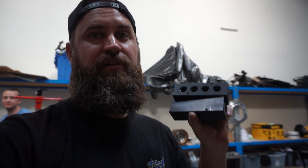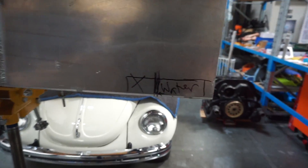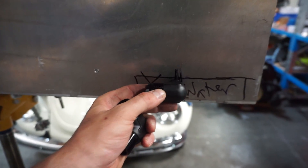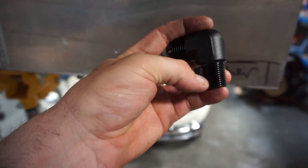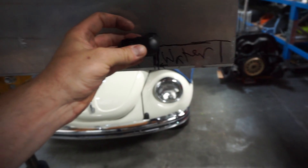Now we move on to the cooling system. We've got these two distribution blocks - one is for the inlet and one is for the outlet for the coolant that's going to cool off the four batteries. On the outside of the box we're going to use some tight 90-degree AN fittings, pipe thread to dash-12. These will run out to the front of the battery box where we've already picked out a mounting location. They'll be stacked one on top of the other. There's a bulkhead nut that goes in the back to hold the fitting in place, and the manifold is going to hang off of it.